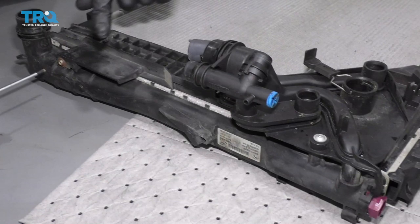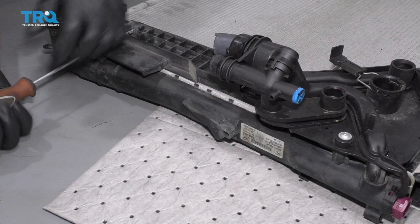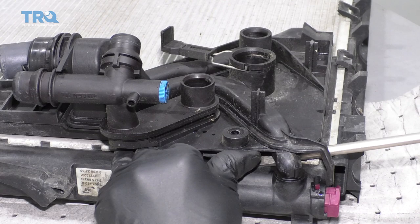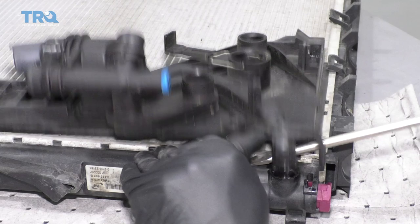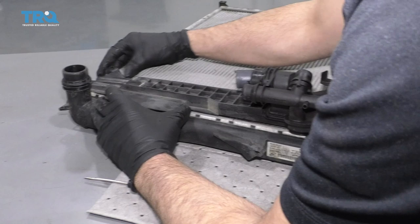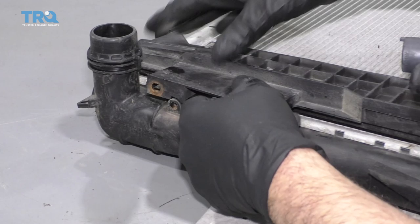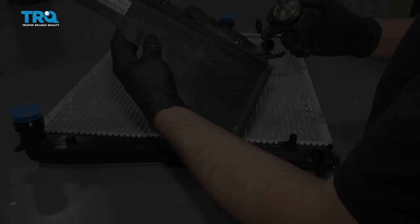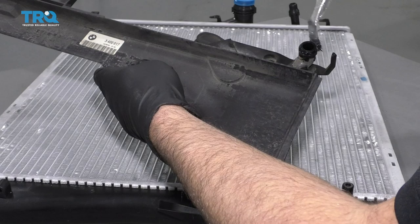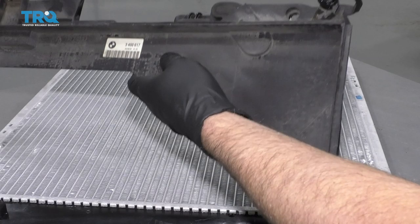Take this screw out and also this screw using a T25. Very gently, take a screwdriver and just pry up under here — I don't want anything to break here. Nothing cracked. You can lubricate the O-ring a little bit. Just slide this whole panel up. You can transfer this over to the new radiator. It's always a good idea to replace that O-ring when you put it back together. I'm going to use some silicone paste to lubricate the O-ring — they do actually make O-ring lubricant, which would be ideal, but we'll use some silicone.